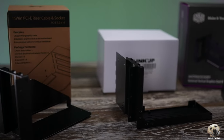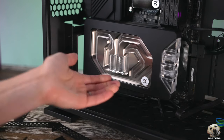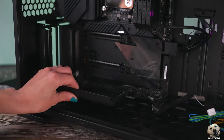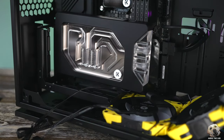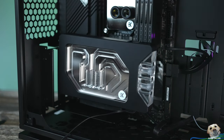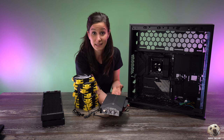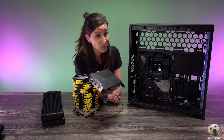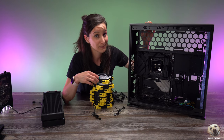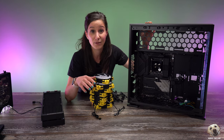The Cooler Master kit is easy to mount and I like how you can't see a platform under the GPU, but it's too tight to fit a fan — you can't even fit two fans down there. The LinkUp feels the sturdiest of the three, but we have the same issues with the fan, and this time our GPU actually touches the RAM — not good. It's the exact same story with the InWin vertical mounting kit. So if you're planning to vertically install your GPU in this case, keep in mind you may have to order a few kits, as two of the three didn't work with this water blocked card.